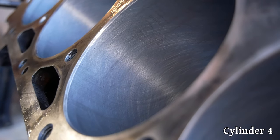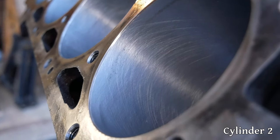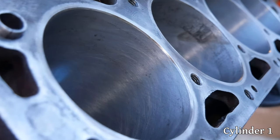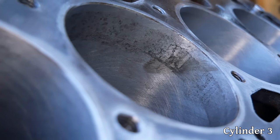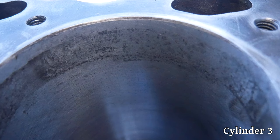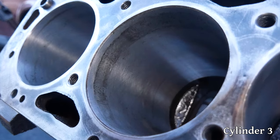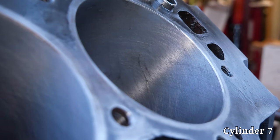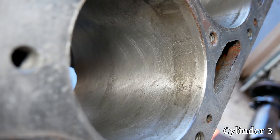It's not the most picturesque but I think it'll be plenty to keep our cast iron piston rings sealed — or at least as well as is possible, because cylinder number 3 still has some fairly bad markings on it. As mentioned previously they feel totally flat and I think that's going to be good enough. At least we'll be able to find out exactly how detrimental staining like this actually is. Other than some more cleaning, this is the last thing we'll be doing to the cylinder walls, so this is what they will look like as we assemble the engine.